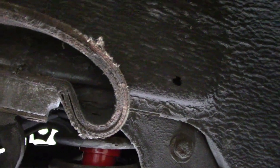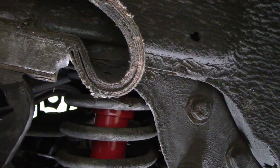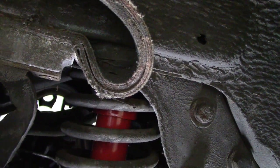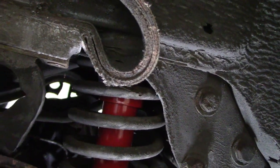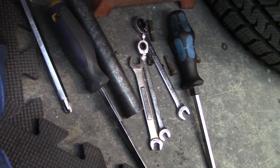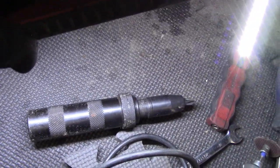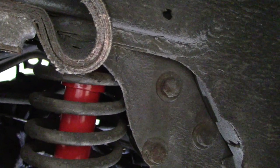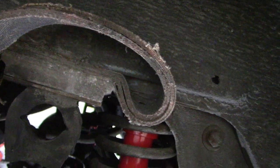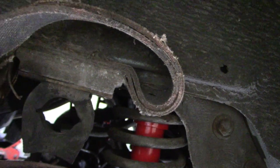I think I jinxed myself on this project. I knew those Phillips head screws were going to be very hard to get out, just based on the position they're in and all of the road grime and debris that gets into them. And the fact that they're a Phillips — I figured they'd probably be seized in there, and I'm right. I've tried to heat them, no success. I've tried big screwdrivers with wrenches on them for leverage, a piece of pipe for leverage, no success. Tried an impact driver — pretty hard to swing a hammer up there. So what we're going to try now is the Dremel to cut a slot and use a big flathead screwdriver. If that doesn't work, we'll just grind it completely off and find a new fastener. I'm not giving up — we're going to tackle this problem.